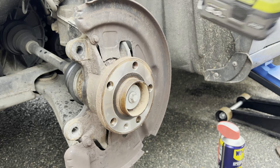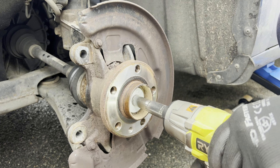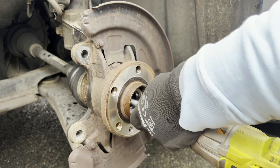Or you can do it just as I did. Leave the car in first gear if it's a front wheel drive car and undo the bolt — you will need a 13mm hex socket and a ratchet wrench. Of course you can use an impact as well, either air or battery. If it isn't a front wheel drive car, just stick to the first method.